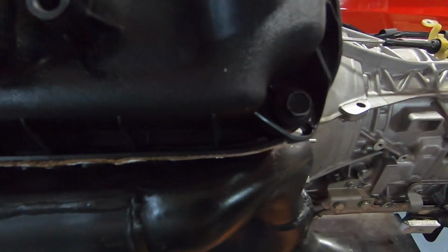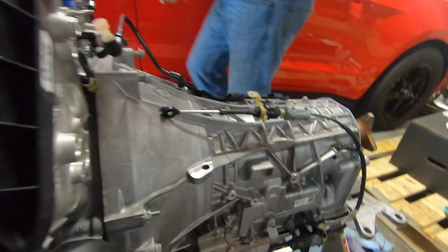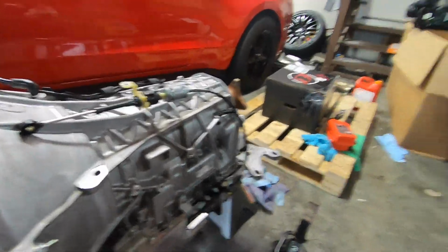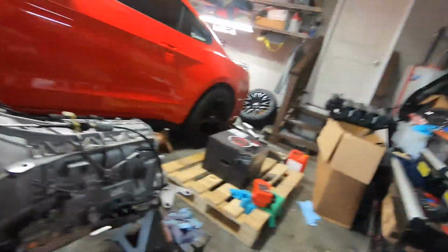Alright guys, so what I'm going to do now is attempt to show you what I was trying to talk about earlier with the ding ding. Watch, you'll hear it. If you reach in here and grab hold, if you look in there, right there, there's a stud sticking through. And if you can reach in there, the ding ding. So anyway guys, if you hear that, you're good. If you don't hear that, if you can't move the torque converter, then take it apart. Not good. No bueno.